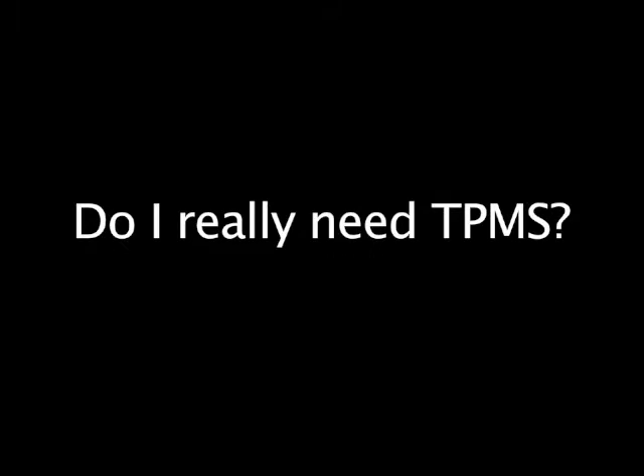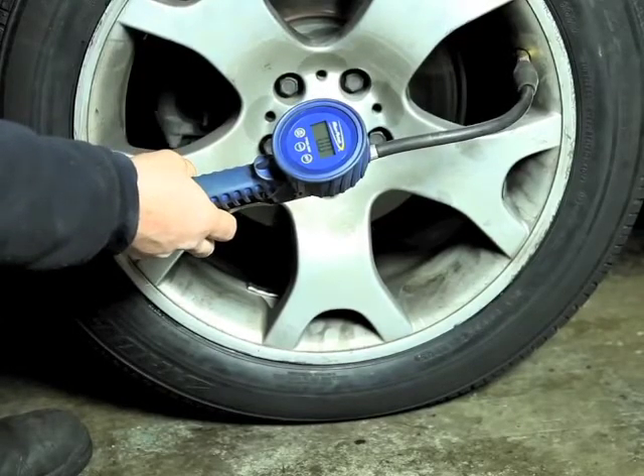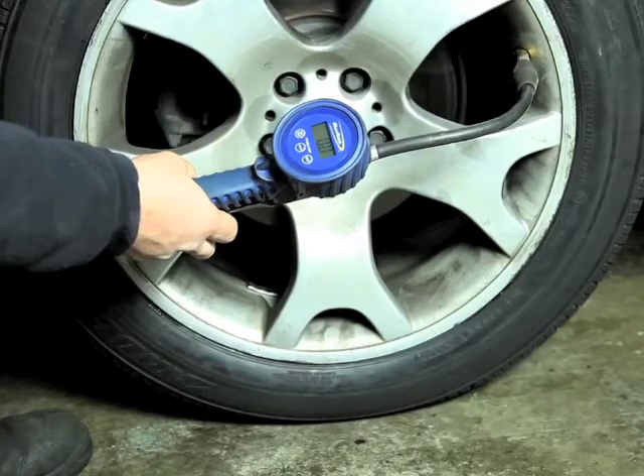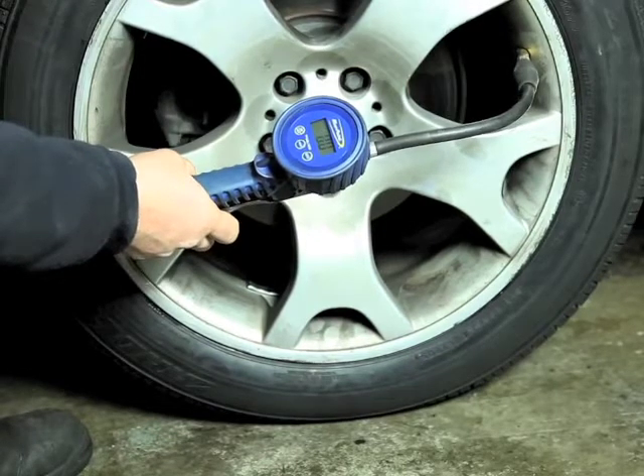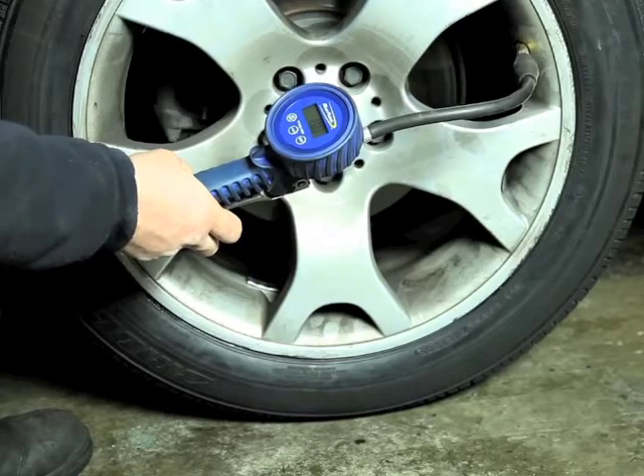You may think you can just look at your tires and see if they're low on air — you'll notice. But truthfully, you don't often see it. Have a look at this low-profile tire from a BMW X5. At 15 psi, it looks almost normal, and yet it's dangerously under-inflated. Compared to what it looks like at normal pressure, there's very little difference.